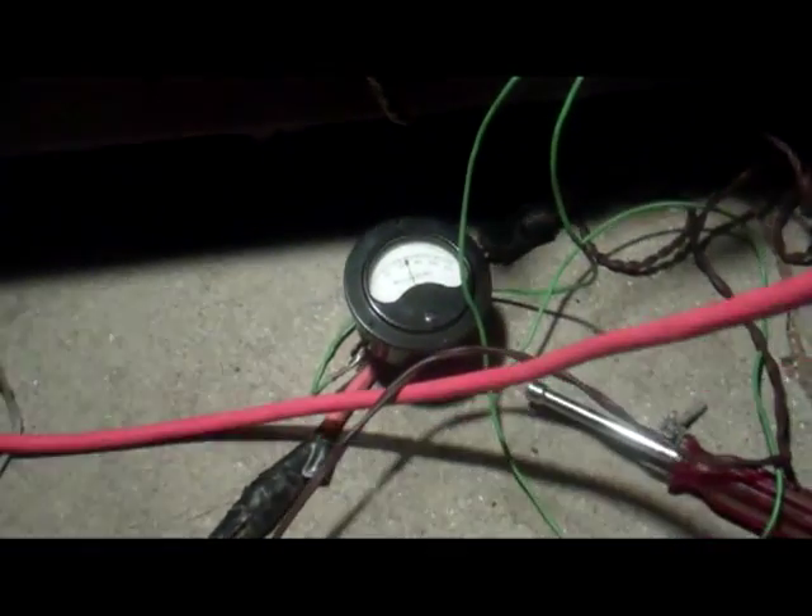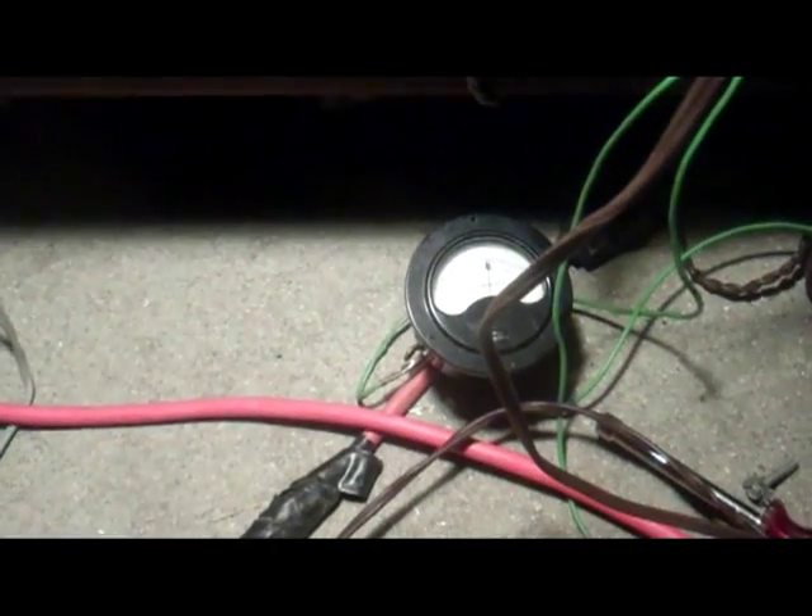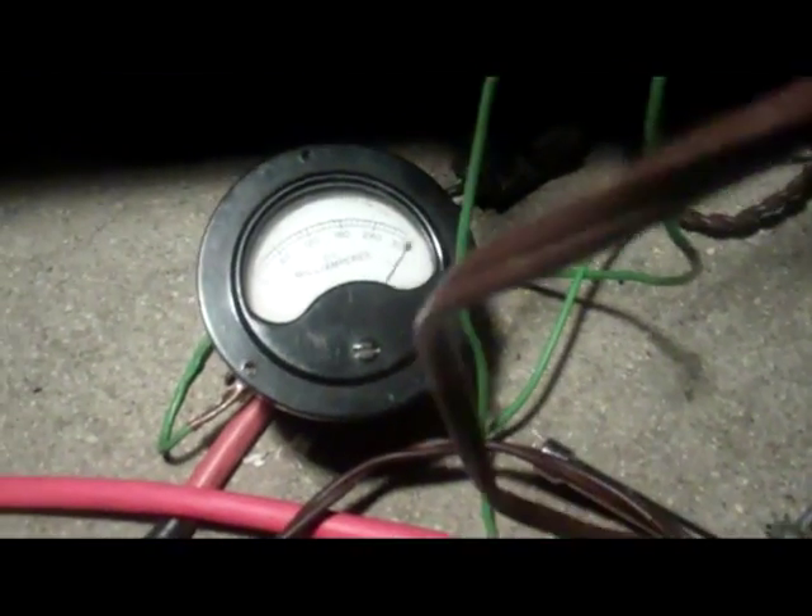Things have kind of taken a turn for crappy here on the Packard Bell. It appears that the flyback has taken a dump. You can see we have no high voltage. The plate current just keeps going up and up and up until the tube starts to red plate, and if I pull the oscillator tube out, it just goes through the roof — so the oscillator is obviously running.